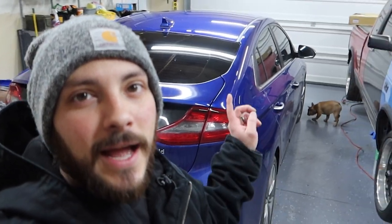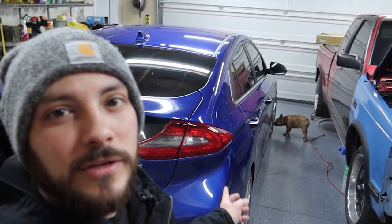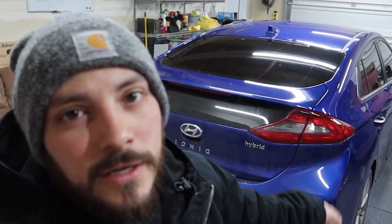I did put a toolbox back there for work to transport it to my new job and figured that might have brought the alignment out of whack. The guys at Les Schwab said there's little to no adjustment in the rear and they'll get it as close to zero as they can. They got it almost to zero, negative 0.7 or something like that. I got a new set of tires put on the rear, rotated them to the front, and they said the same thing — camber wear.